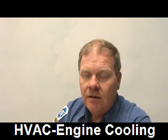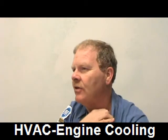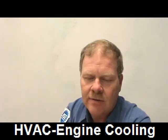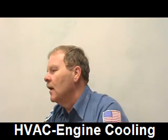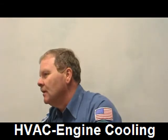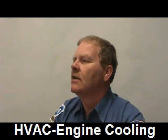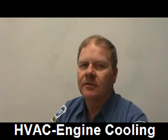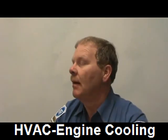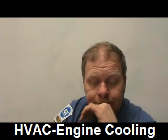On a contemporary cooling system — even the V8s like the 302, 350, Chrysler 318 and 360 — you better find the thermostat. On the old VW Rabbit, the thermostat was in the bottom radiator hose, and those radiators didn't even have a drain on them. They expected you to pull the lower hose off and pop the thermostat out, and it was messy.